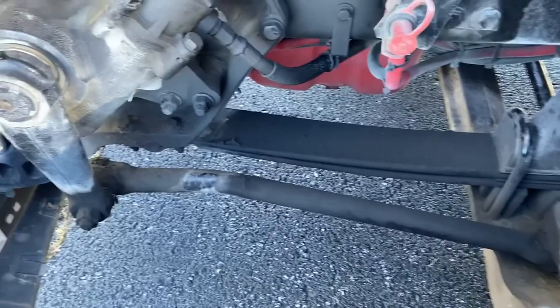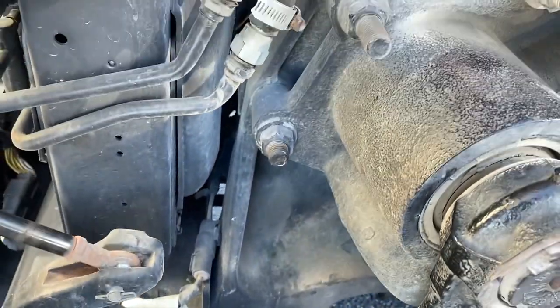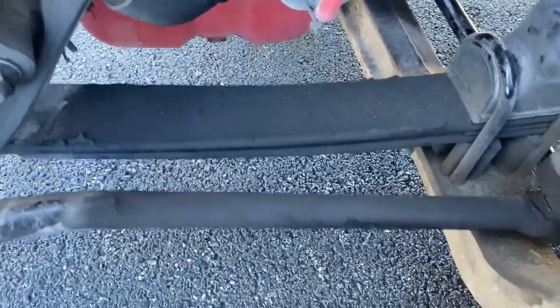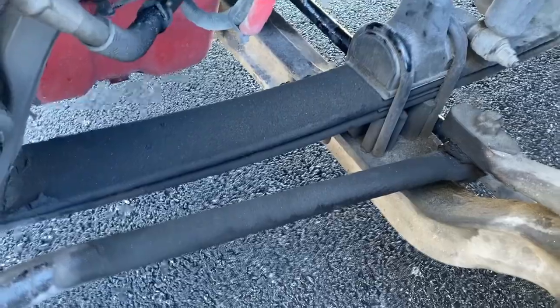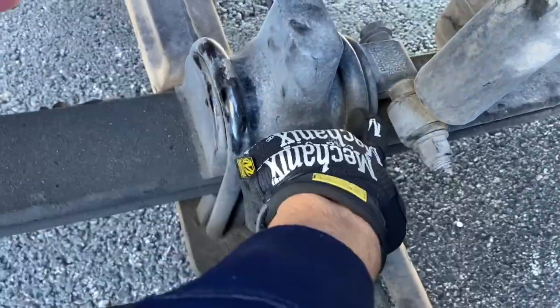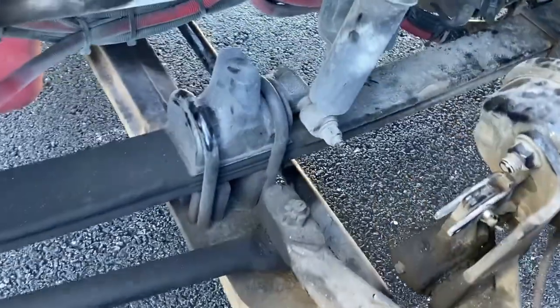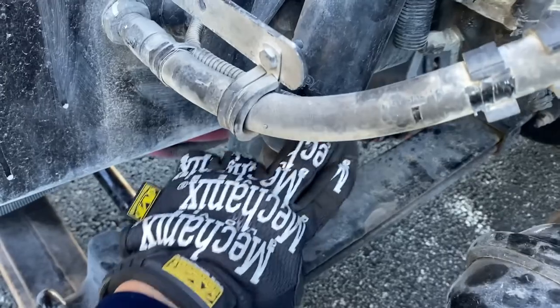From there I move on to the suspension — the suspension mounts are right here, secured, all bolts are in place and not missing. Then I move on to the actual leaf springs — mounted securely, no bolts are missing. The leaf springs themselves are not cracked, bent, or broken, they are properly aligned and lined up right on top of each other. They're also mounted securely with two U-bolts, all mounted securely and not missing. Then to finish off the suspension I move to the shock absorber — it's mounted securely with a bolt on the top and bottom, not missing, no visible leaks, not cracked, bent, or broken.